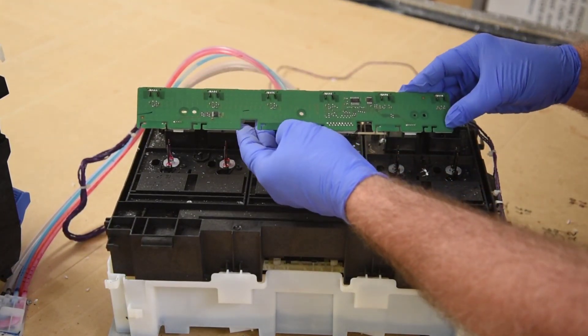So I've got a few more screws here to remove. But if I remove the ink tank from the ink tube plate down here, I think I'm in for a huge mess. Let me see what's under these plastic covers - they look like they just clip on. Two springs that push on the arms that ride against the lower cam - the one that pumps ink to the printhead. The arms look like they have a rubber tip clipped in the end. The arm riding on the upper cam also looks to have a rubber tip - just a much bigger one. I would guess that is the pump system: a rubber diaphragm that is moved by an arm riding on the cam. All of them look clean except for the one. It could be just a cracked rubber diaphragm that is causing the leak. Let me see if I can remove the plastic arms and get a better look at what is pumping the ink.